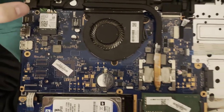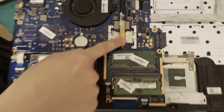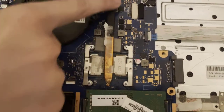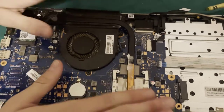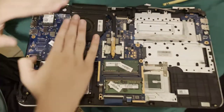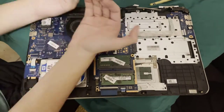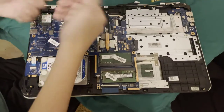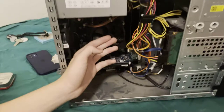Next, the CPU. This one is a little different — the CPU is under this, and instead of being right under the fan, the heat sink moves all the way over and then puts heat into the fan, and the fan blows it out. The reason laptops are so loud is because there's usually an entire keyboard over this, so the fan is blowing into the top and the air can only come out the sides — it's not breathing into open air.